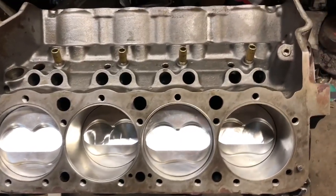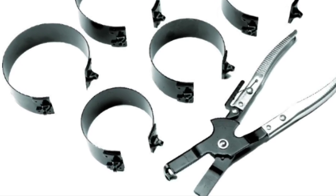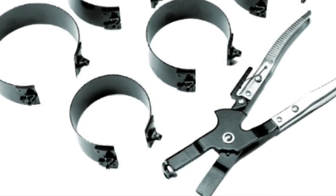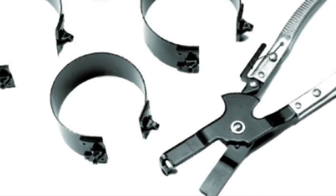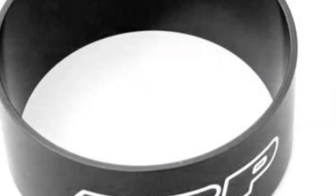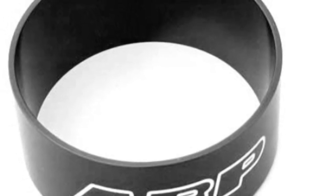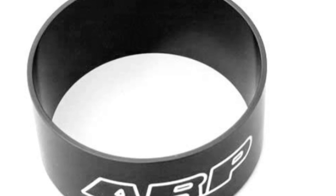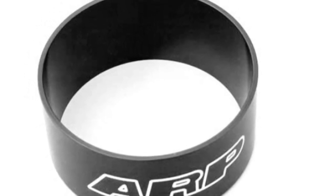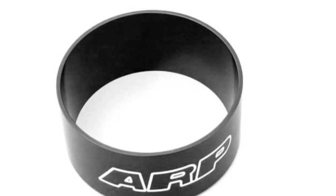That turned out pretty good — wasn't too bad. I had a couple of issues with a couple of cylinders initially. This is the type of ring compressor I used tonight — it works really well, typically fits down pretty good around the o-rings so you don't have to pull the o-rings out of the block. It does get a pretty good grip on the piston though, so you have to be careful not to over-tighten it. Of all the piston installers I've used, this one typically works the best. These are also fitted for your specific piston — if you have a 4.125 bore you'll use one for that, and a 4.155 bore requires a different one. Not universal.